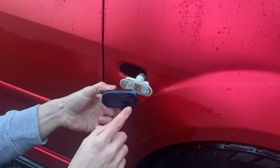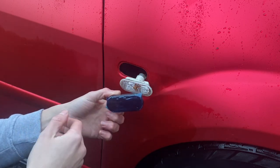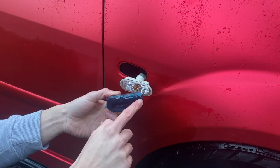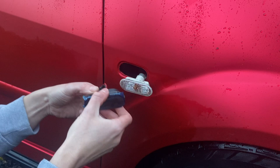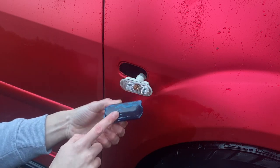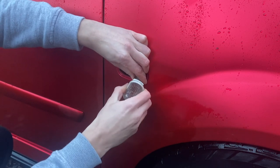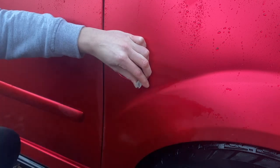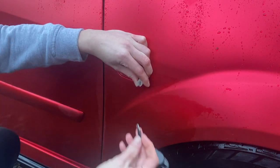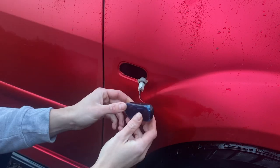The new ones replicate the same clip design. Because these are dynamic, they're meant to flash front to back, so I want to test which way around they go before hooking them in - Una told me that once these are in they're quite hard to get out. I'll remove the old bulb by twisting the bulb holder and pulling it off.